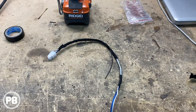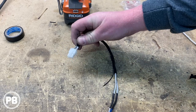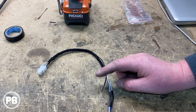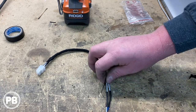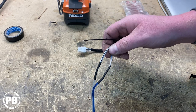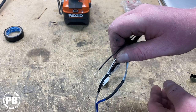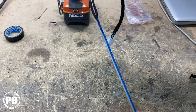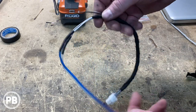For our signal we're using the high level input cable that came with the subwoofer rather than using a line-out converter and RCA. We've prepped our high level harness input that will plug into the bass amplifier itself. It does come with a ground wire — we generally use that if we have a ground loop noise issue, so we're not going to hook it up unless we need to. The speaker wires are going to snag signal from the passenger B-pillar panel. Since it's a sub, we don't need a left and a right, so we combined both negative inputs and both positive inputs, soldered those on, and put heat shrink to extend those wires. We're going to run this to the passenger B-pillar area.